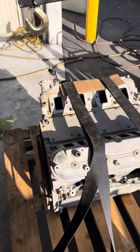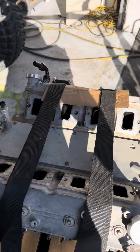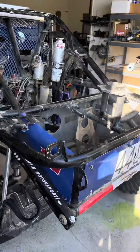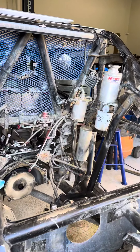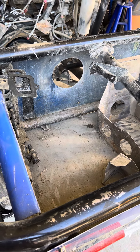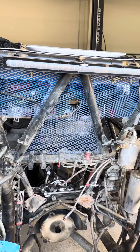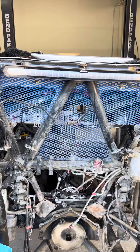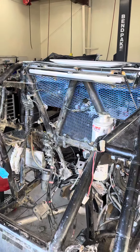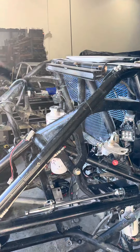You can see all that dirt on there — some of that was sucking into the engine, so we lost a ton of power on our last race. We also have to reroute where the air filter goes. It was down here in this box, just sucking dust all the time — that's where the dust cloud kicks up. We're going to put the air filter somewhere either higher up or inside the cab, like some of the higher horsepower rock buggies do, or just somewhere where it's not going to suck as much dust, so we can maintain our power throughout a long race in the desert.